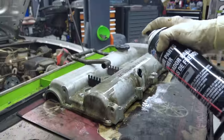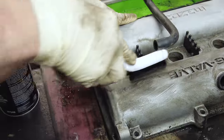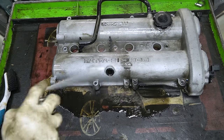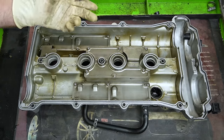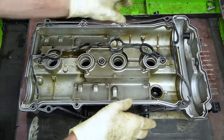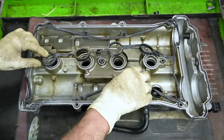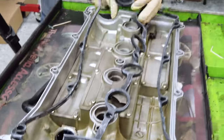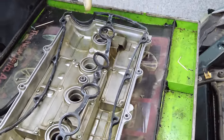Before we put our new gasket in I'm going to flip this over and do some basic cleaning and try to make this look a little nicer. We're not doing a super decorative valve cover job yet but I also don't want to put it back with all this oil all over the place. We'll hit it with a little bit of brake parts cleaner and give it a scrub. You can also use degreaser for this as well — make sure you're working in a well-ventilated area. Once you're as clean as you want to be, it's time for our new gasket. I like to lay the gasket out and test fit it to make sure I have it in the right orientation. This one's pretty easy because there are two humps on the front side and one hump on the back side, so you can't put it on even remotely wrong.